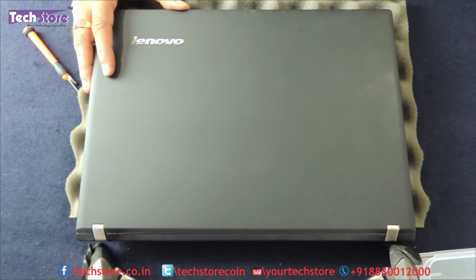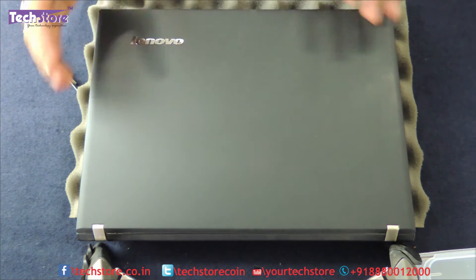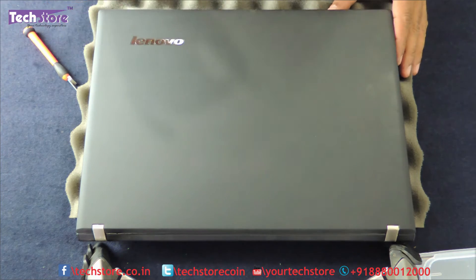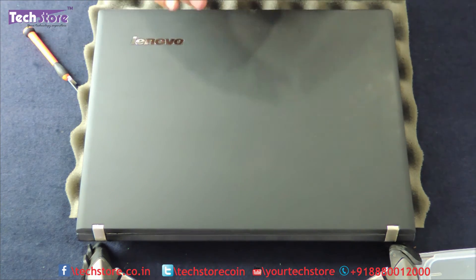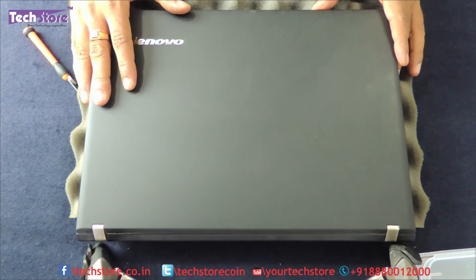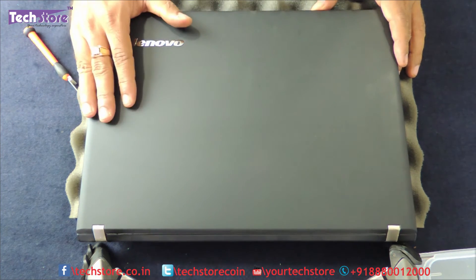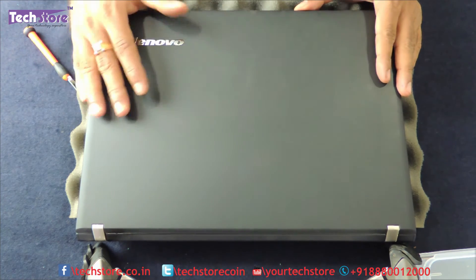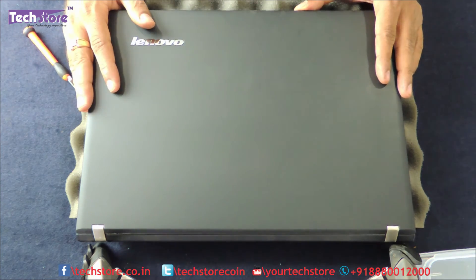This video showed you how to upgrade your Lenovo E4080 or E5080 laptop. The E4080 is the 14-inch variant and the E5080 is the 15-inch variant — the process is absolutely the same with the same maintenance hatch. You can replace the RAM with 1600MHz DDR3L low-voltage memory, the hard drive with a 2.5-inch slim SATA hard drive, and also replace the WiFi chip and CMOS cell.